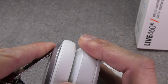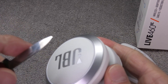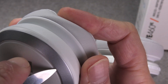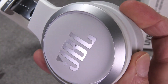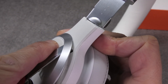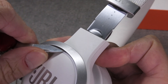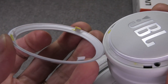I'm slowly and carefully working my way around. There are three clips that hold the silver ring in place, so you really want to work around the entire ring carefully — not to break it or cause any damage to the ring or any of the plastic pieces, as they are a little bit fragile. Also notice that this plastic ring is glued into position at a couple of different spots. At the very top there's more glue than anywhere else, so work very carefully there to remove that glue.